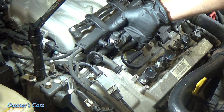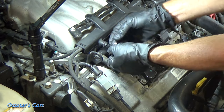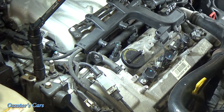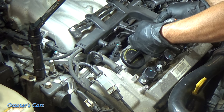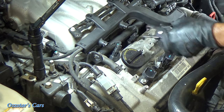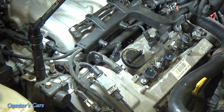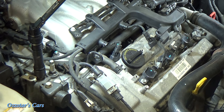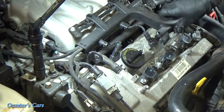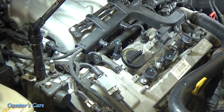Now I'm releasing the fuel injector harnesses. What you do is slide the white piece up, then there's a little black tab — squeeze that down and pull up. If you have a pair of these fancy bent pliers it makes life a little easier. What I like to do is use a pick to pull that tab up, then get the pliers on there, and it usually works pretty well. It's very tight down in there but it's doable.